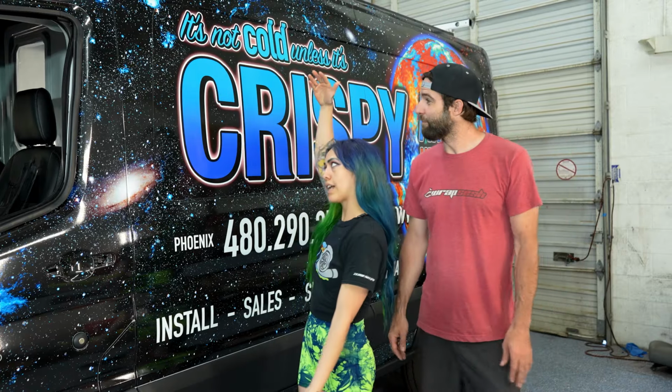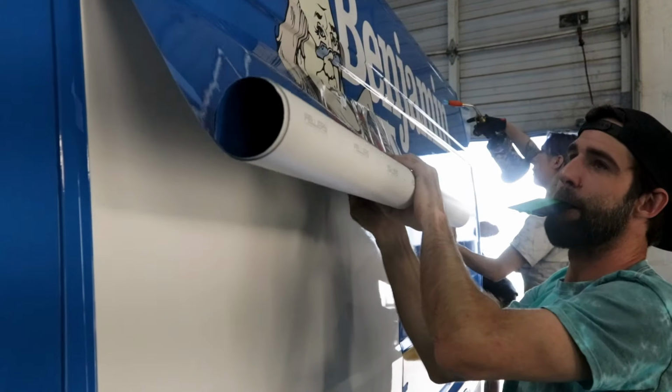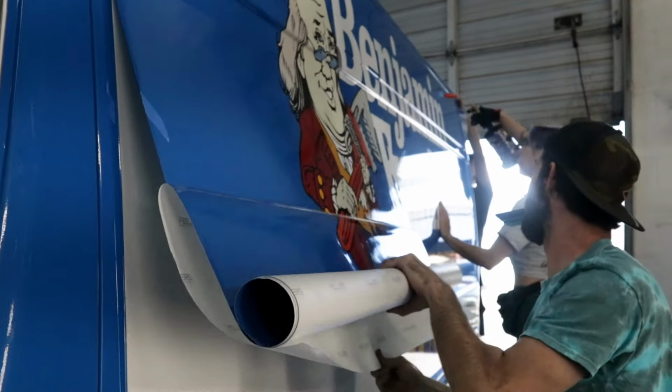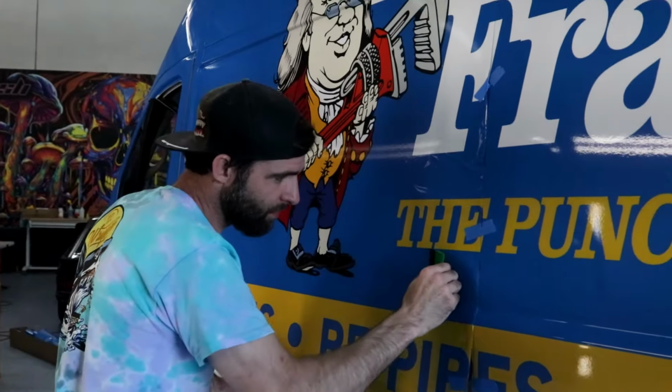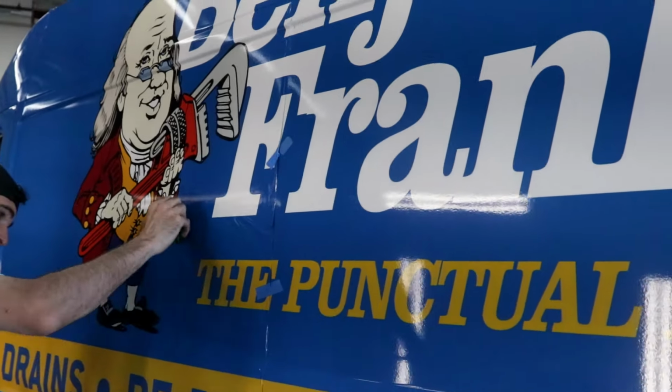Yes. And then when you get to installation, when you're doing a fleet wrap like this, the easiest method is going to be roll down panel method. You're definitely not going to want to pre-seam anything and full pull everything all at once, because it's going to tack down a little too much for you and it's going to create bubbles. You're going to work, and then you're going to have to push all those bubbles out and work it the entire time. So the better way to install this film is to do your panels like a normal graphics install, the roll down. And roll it down maybe a couple feet at a time. Don't full pull the entire panel, because it's a little too tacky to do that right off the back.